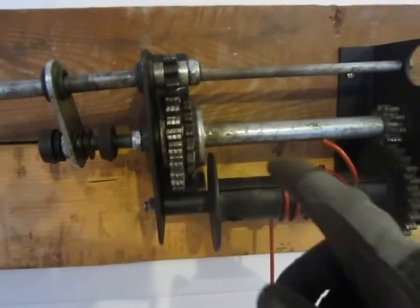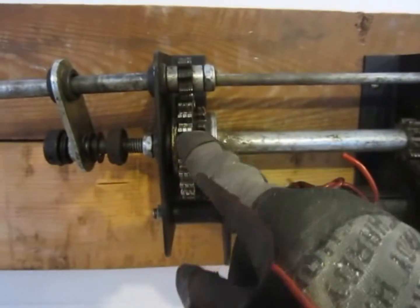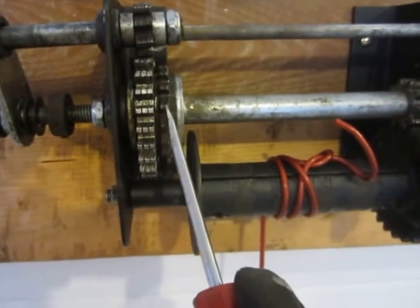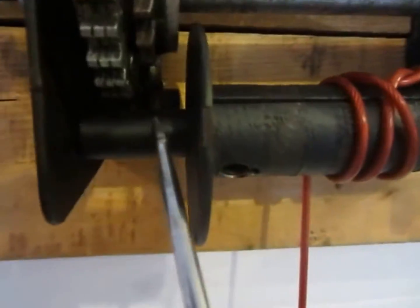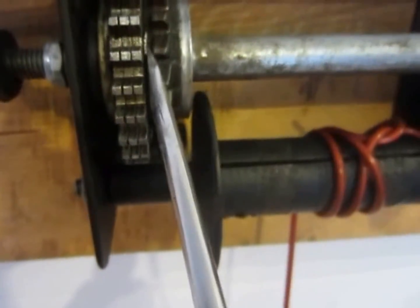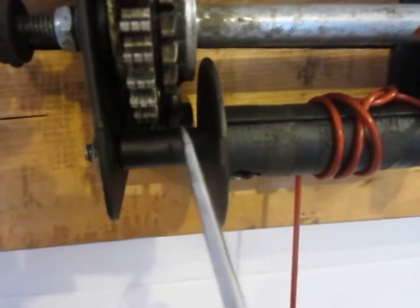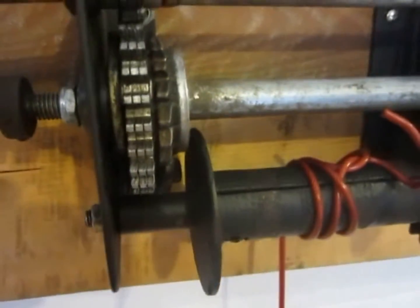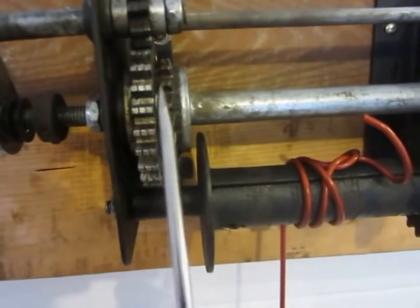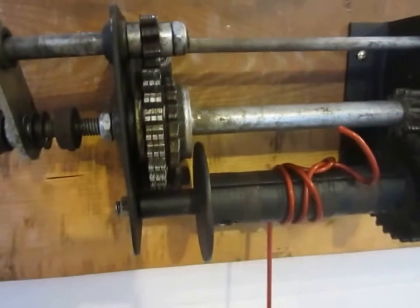My plan here is to take everything apart. What the problem is, there's two friction pads, one on either side of the gear, and this is the locking gear. I don't know if you can see this, but my locking pawl is actually not even centered, so this friction pad probably wore out so much that it is pushing over. Now the locking gear isn't even resting really on there. Also, part of the problem is the brake pad is now fused with this main gear here, and that is the second problem we're having.